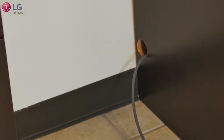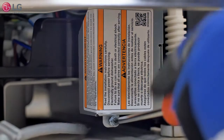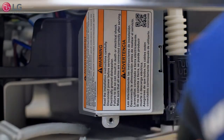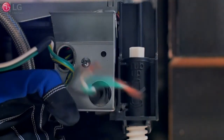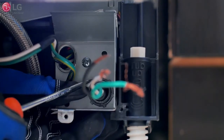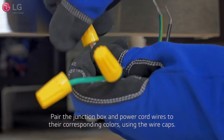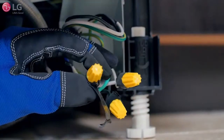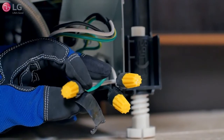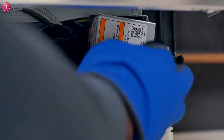If a three-pronged power supply is used, it should be in an accessible location adjacent to the dishwasher, within four feet of the dishwasher's side and not behind the unit. Use a Phillips-head screwdriver to remove the screw from the junction box. Slide and secure a strain relief onto the power supply. Insert the power supply with the strain relief into the junction box as shown and secure it with a ring nut. Then pair the wires to their corresponding color — neutral, power, and the green ground wires — using the wire caps attached to the power supply.